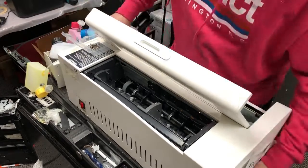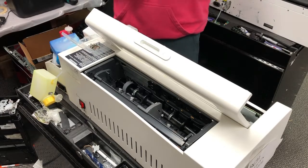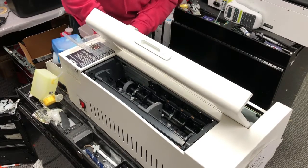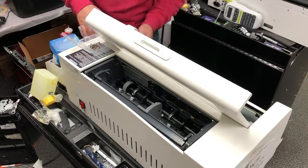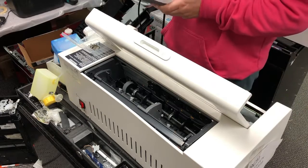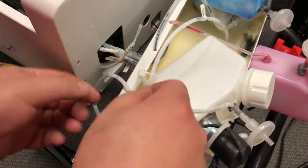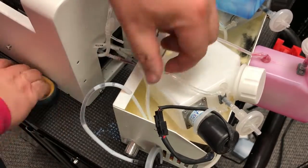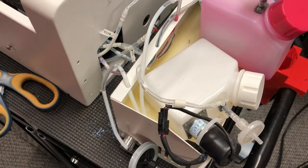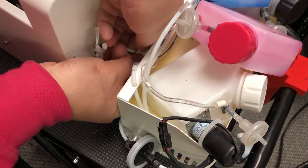What I like about this printer is every screw is sideways, so you don't need a really long screwdriver to dig down and remove them — you can just walk around and remove the casing. What I don't like is the ink tank is individual, not together, so it's tedious. I have to get a box, take the tanks out, remove the platform, then dig inside. However, every tube is labeled and the tube sizes are good, except for the white ink — a silicone tube would be better, but it'll certainly work for a couple years. Before you cut a tube, put your own label on it so you don't have to figure out which tube is which later.